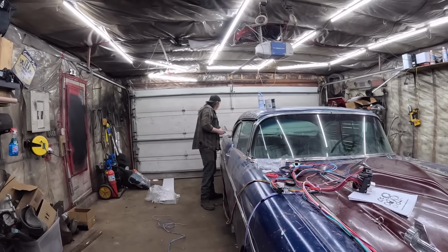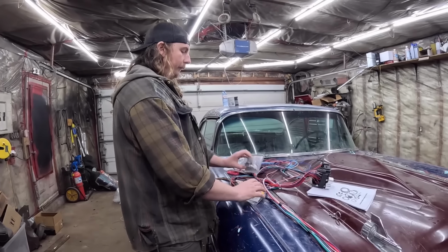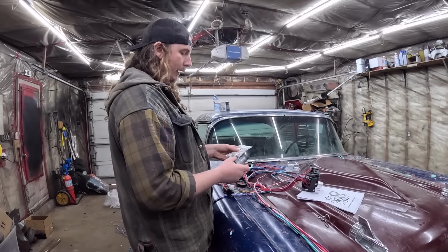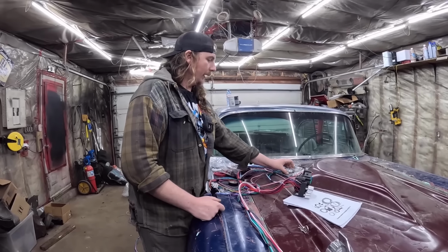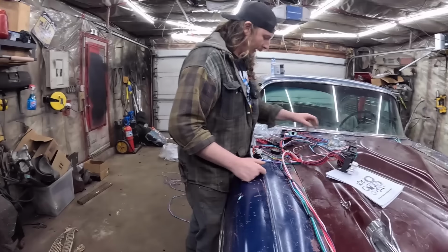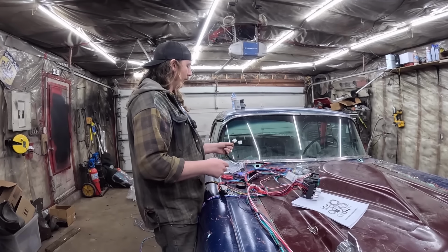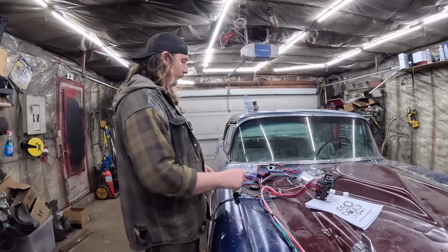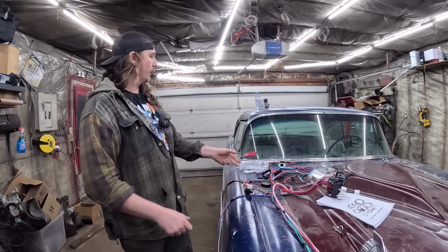This is all the tricks of the trade to wire any hot rod for as cheap as possible, as far as I'm concerned. It's a $15 universal headlight switch. So we got one of those in there. I bought a factory Tri-5 ignition switch, which was actually a lot of money. Looking back, whatever. You can buy cheap ones of those too. I don't have the little ring. I gotta find one. There might be one in that bucket right there, actually, of miscellaneous. So we got that. And then just some cheap taillight deals. And then the kit comes with headlight pigtails. This is for an old alternator, so we'll keep this. And steering column. So we'll get to, oh, a little piece of wire there too.